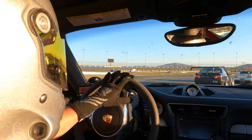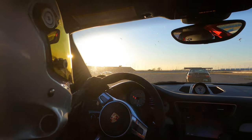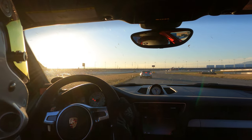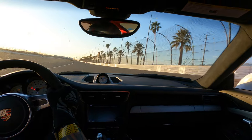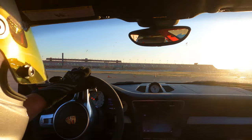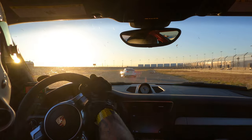I want to try out the A7 with the F80. I'm going to be running that tire for Bimmer Challenge if I can afford the points — it's one more point than I'm running right now. I'm adding a full cage which should free up one point to run the A7. I hear the A7 is faster, but the window to set a hot lap is smaller. The 'A' stands for autocross and the 'R' stands for racing — autocross tires need to come up to temp very fast and set that lap time right away, as opposed to this tire where temps don't need to come up immediately.